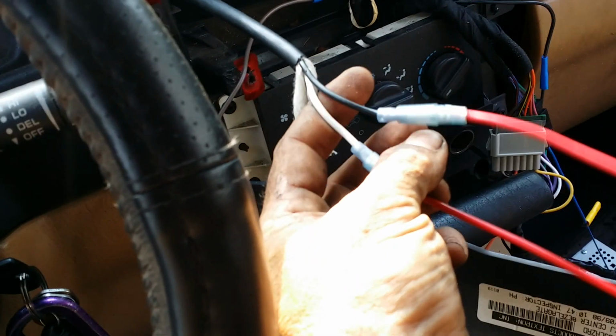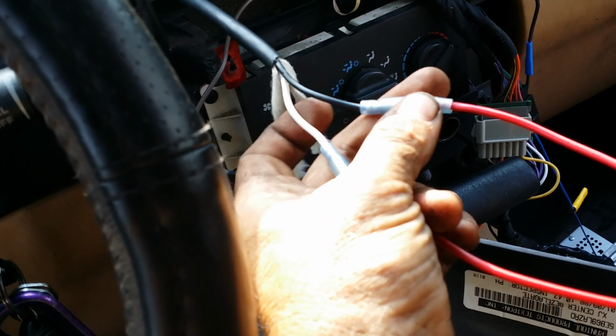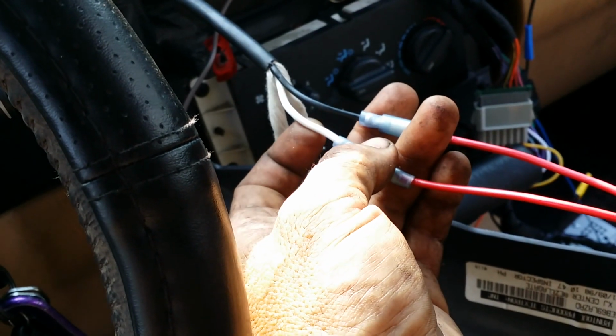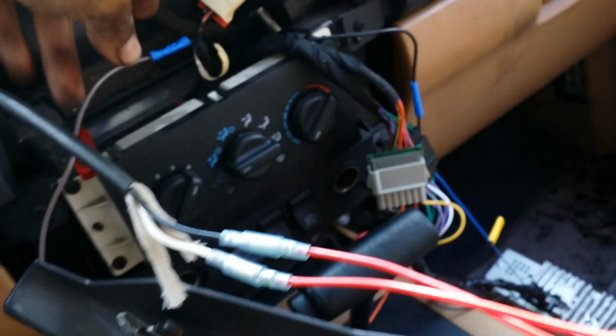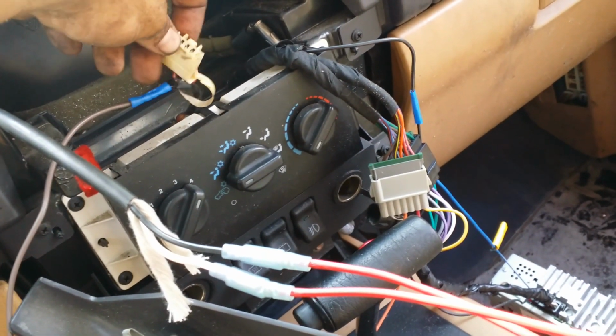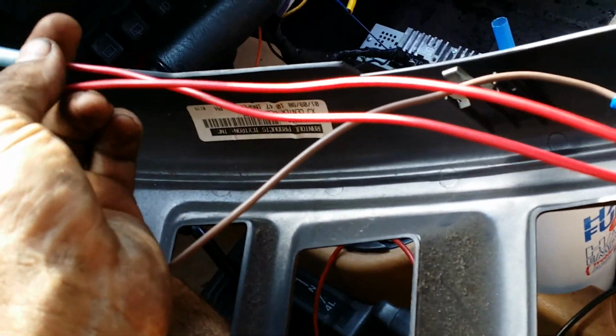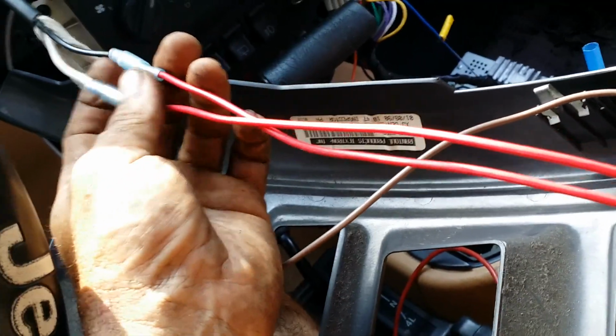We'll run it up there and get this thing working. All right, and here we go. There's our wires going out to the winch, to the solenoid. I get it all mixed up, I'm sorry. The contactor. This is power to one side of the contactor, it's power to the other side of the contactor. Okay, I pulled a voltage wire off of this plug right here. It's something for the old radio, but it'll be the radio fuse. Now it goes up into here. You can't make heads or tails of it, I know, but that's your power wire to the switch on off. I made these little pigtails where I could work with it easier, but it's going to come here and connect. That's how it's going to work.